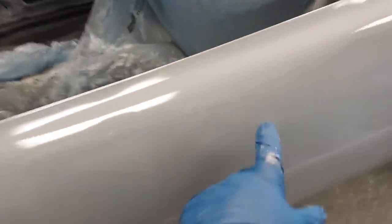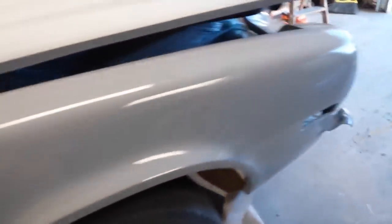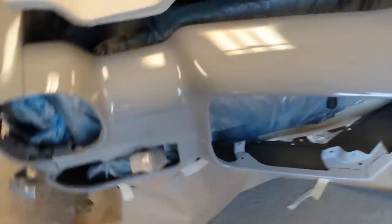Considering the hodgepodge of repair panels here, I got a big dent coming up right there - the old moose knuckle. So we're in epoxy, letting it flash off, two good coats. Shiny stuff, goes on like syrup. Don't love it but this is a step forward - it's all one color again and it doesn't look too bad.